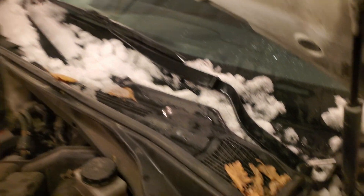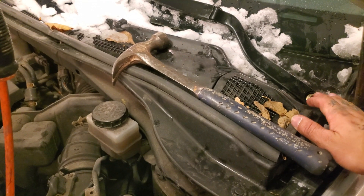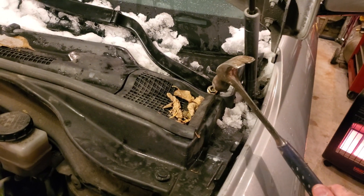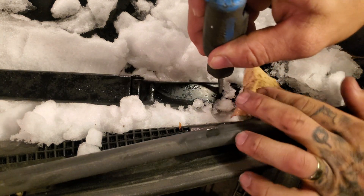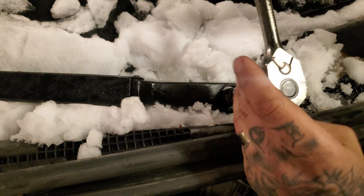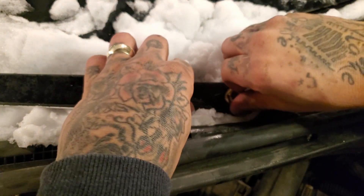There's a plastic cover on the windshield wiper arm, so get your flathead screwdriver, stick it in there, pry it a little bit and that should pop right off. Next you need your 14 mil with your extension. Put the nut on by a couple threads — just enough so you're not stripping the top thread — then hit it hard enough that it pops free. Then move on to the passenger side: pop off the plastic piece, take your 14 mil and ratchet, keep it on a couple threads, and take your hammer. That should be enough to take it off.